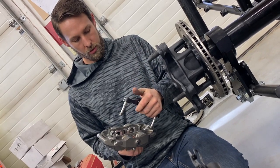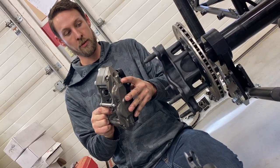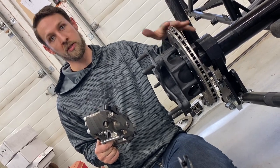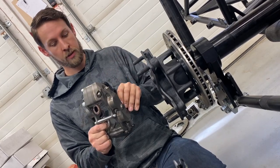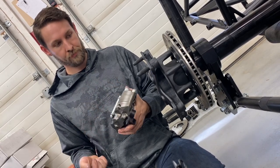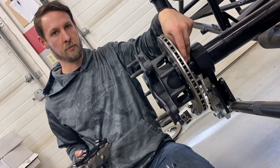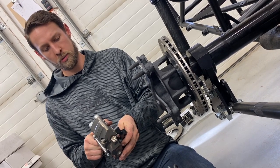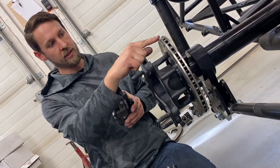This is a dynamic-style caliper mount. When you put the caliper on you can adjust the height of the caliper for what size rotor you have. I'm running an 11¾-inch rotor and they have 12-inch and 12⅛-inch sizes. As that diameter gets bigger, to line the top of the pads up with the rotor you've got to space this out. There are also different quad lock mounting brackets from McNeil to space the caliper out, but what this allows you to do is put small shims in there — as thin as ten-thousandths — to get that pad to the top of the rotor perfect.